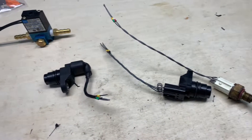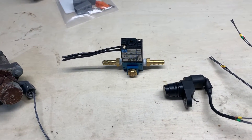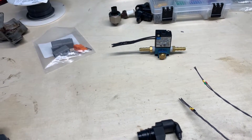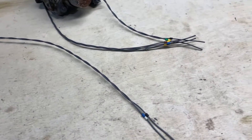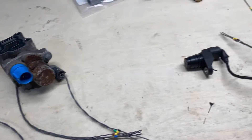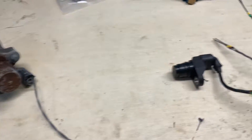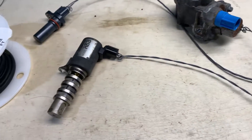Back in the wiring room. I've got a boost control solenoid here — it's a Chinese solenoid so I need to make it easier to replace because I guarantee it won't last. These sensor connections are all ready to go — wires are color-coded, twisted, looped, and potted. Everything is ready for insulation. Let's do a time-lapse of the insulation going on and then I'll add the SCL to seal it.